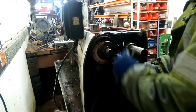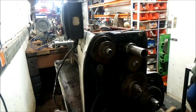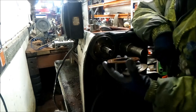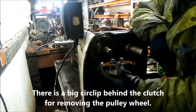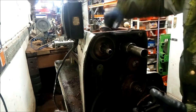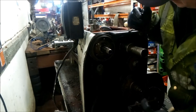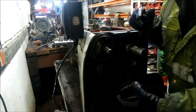And you can pull it off. I had to do that because this was all stuck together. Yours might just come apart nice and easy, but because there was no instruction book to tell me how to take these off, and obviously I didn't want to wreck it or break it - it had almost friction-welded itself together. The idea being that this should spin freely when the clutch is off. So now I can give this a wipe round and a clean up and put it all back together again, and hopefully my clutch will work.